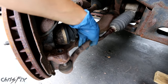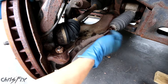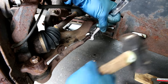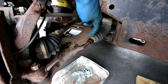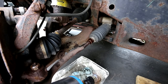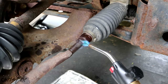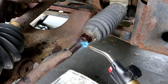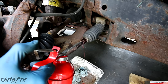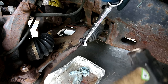Next thing we're gonna do is get this lock nut right here loosened. Put your nut back on just tightened a little bit — it doesn't need to be tight. This is a 7/8ths on this vehicle; usually they're relatively large. Hit it with the hammer just like that. Now these can get pretty stubborn and a lot of times you need to use heat, so I'm gonna go get some heat. Watch the rubber boot here so you don't damage it. Quench it a little bit with some penetrating fluid and there we go.